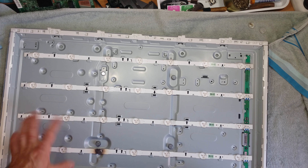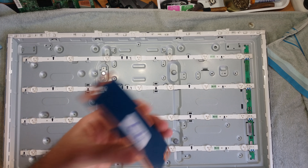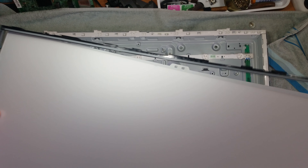After that I looked up the common problems with these TVs and found that the T-board is the issue. I found a video on YouTube — I'll put the link in the description — those guys know what they're doing. They recommend that when the TV starts up and then shortly turns off, you should change the T-board. So I bought the T-board.